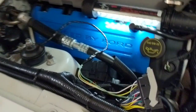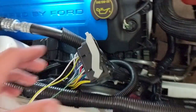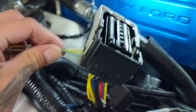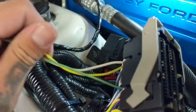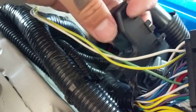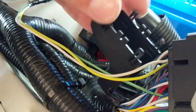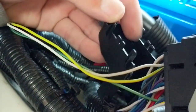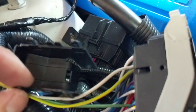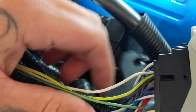A lot of people have been asking about wiring in the paddle shift. Originally when I bought the motor I got the OEM harness with it. I pulled some pins out of that — it's pretty easy. It does look a little confusing at first because it's so blocked in and taped up, but the pins pop right out. I used an L-shaped pick for that, popped it out, and took off the tape.